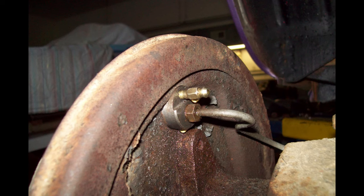This nut on the end of the brake line was frozen solid and I didn't try to heat it or anything. I just used penetrating oil on it but it would not come loose. Here's a little trick: if you don't notice a frozen nut on the line, you'll twist that line before you realize it. What I did was just break the line loose, then take the wheel cylinder completely loose from the backing plate, and then spin the wheel cylinder off the line. So that works — and put it back the same way.